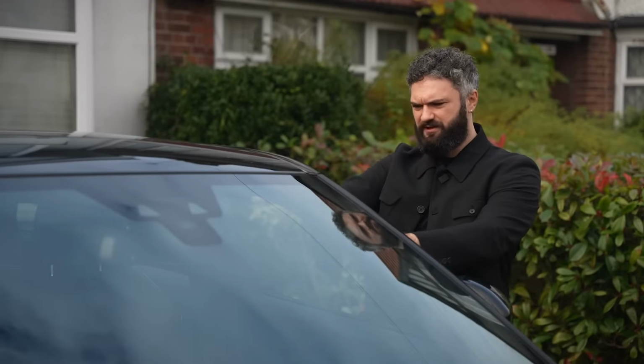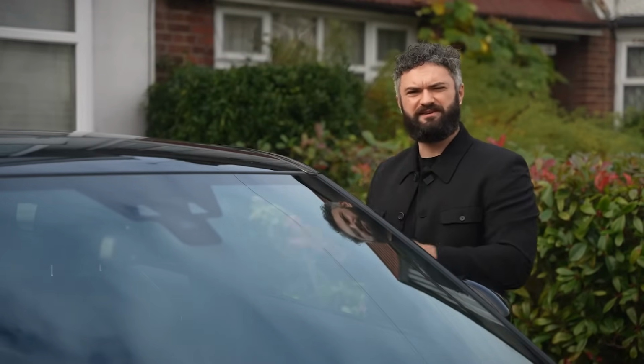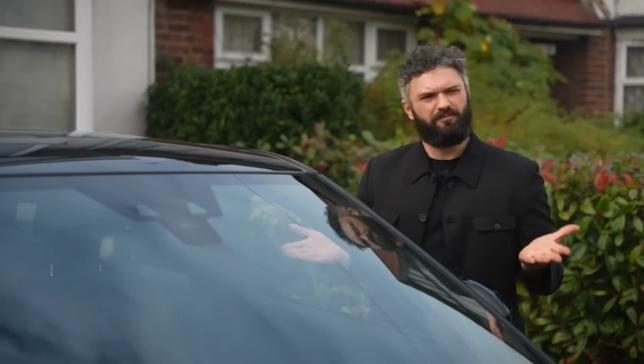deflectors are held securely. So it's worth noting that on older cars, the rubber seals can become hard over time. So if that's the case, we'd recommend applying some rubber softener and leaving that for 30 minutes before you try to install. This is just an optional step, of course.